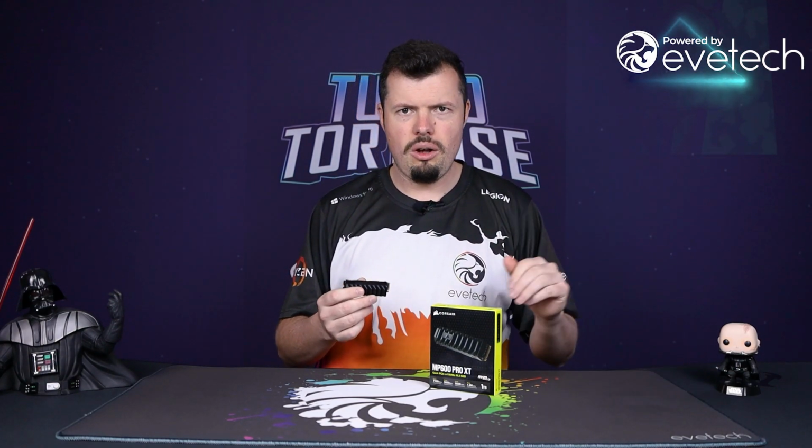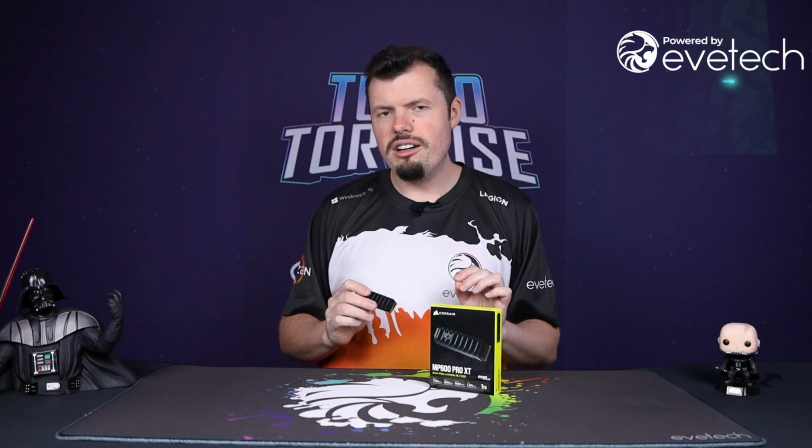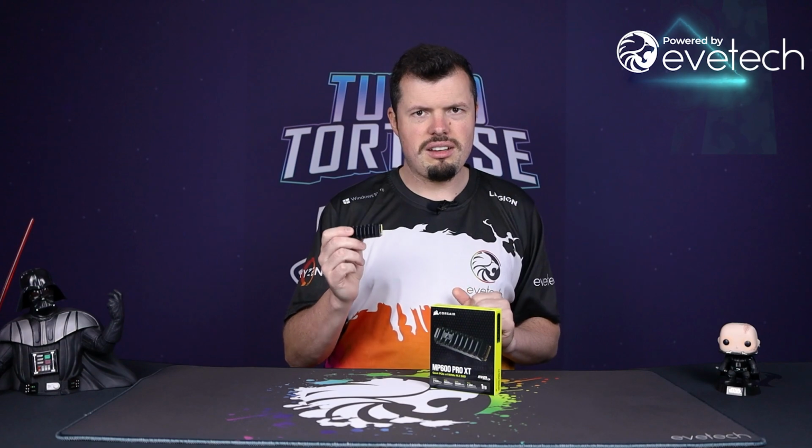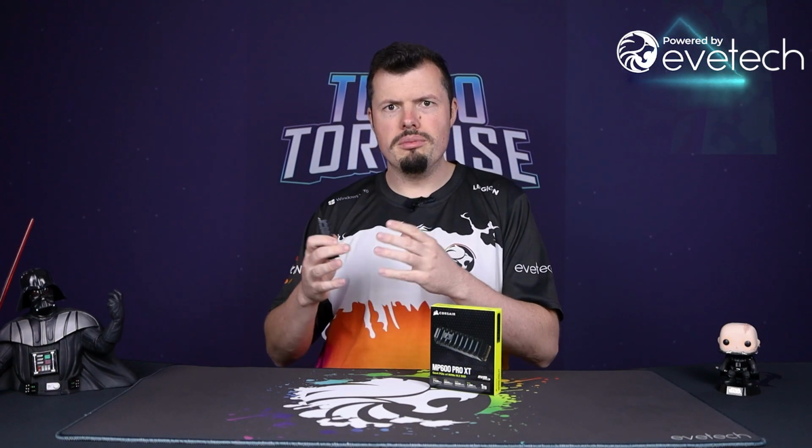And that's a good thing to see, because multi-threaded processing is what we're doing in this day and age. I doubt you're going to be buying a 5,000-6,000 Rand NVMe and then putting in a quad-core CPU. I really hope that's not what you're doing with your life. If you don't have an 8-core or better, with this kind of drive, you're kind of wasting your time in a way because it can handle so much more data transfer.